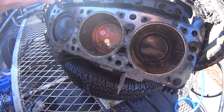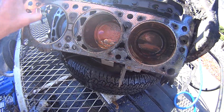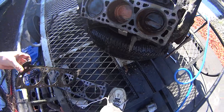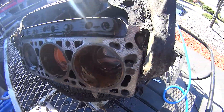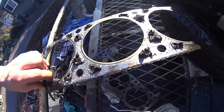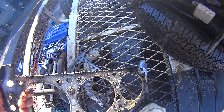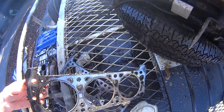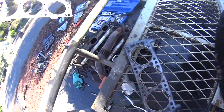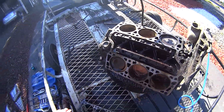We'll go ahead and remove the head gasket off of here. Guys, it's kind of goopy. Look at it — it all stuck to the block. You can see the edge of this head here. This is why it will overheat or overcool. Sometimes it'll get a little leak and not enough cooling will go through, but typically it will overheat.